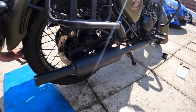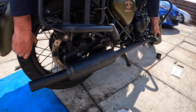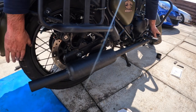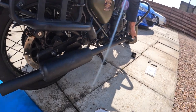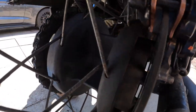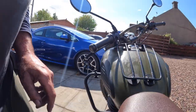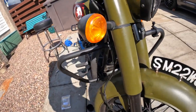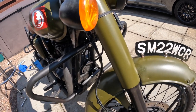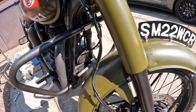I've just finished doing the back, which was a faff. I have to say, getting that back wheel realigned, what I did was I loosened the wheel nut, dragged the axle out just to halfway, thinking I'd get the caliper out, but I had to pull it right out and drop the wheel down onto the ground. And then the right hand disc side spacer fell out and I couldn't get realigned. It was a real faff, and I think it's just practice with these things, you know.